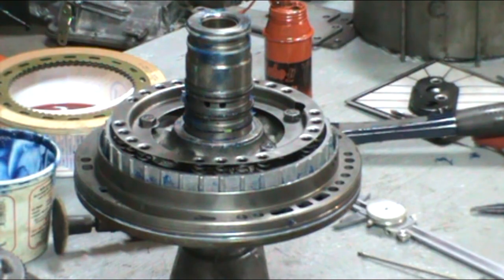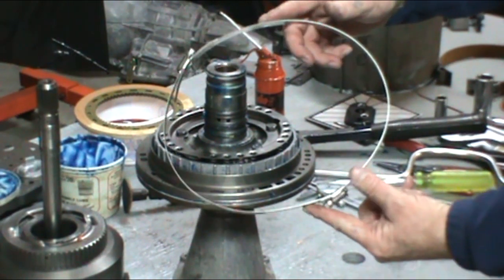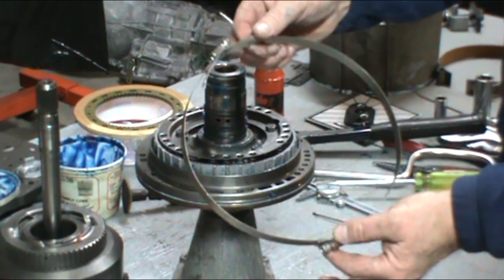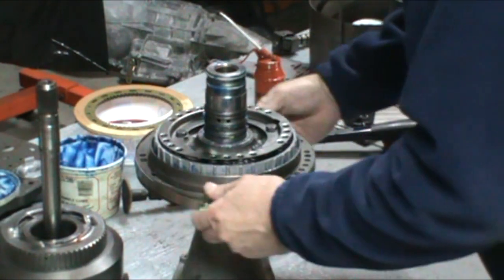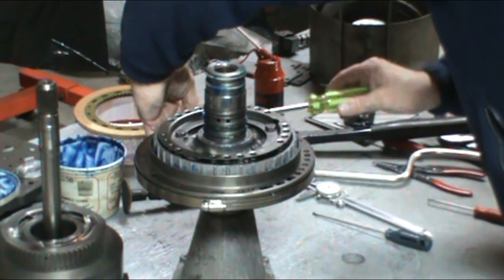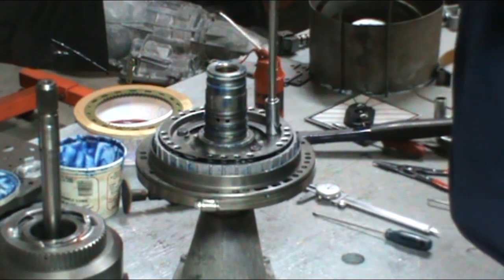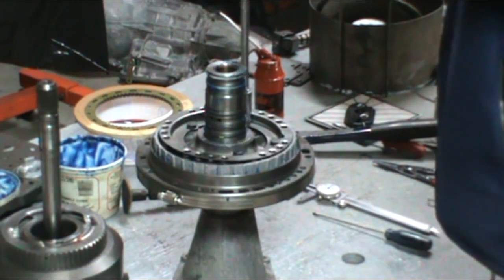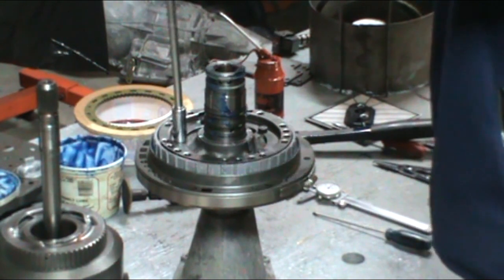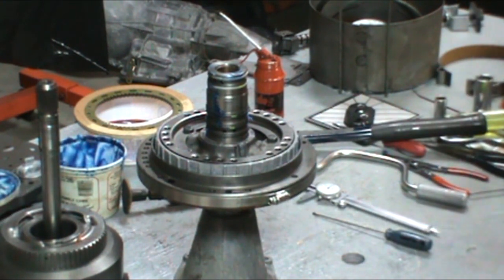Before we tighten up the bolts, we want to get our large band that we're going to put around the outside of the two halves. I went and bought two gear clamps, 5 to 6 inches, and put them together, and just install that around the two halves. That will align the two pump halves, so when you go to put it in the case, you won't have a misalignment problem. Once you've got that snugged up, snug up the bolts, and torque those bolts to 20 foot pounds.